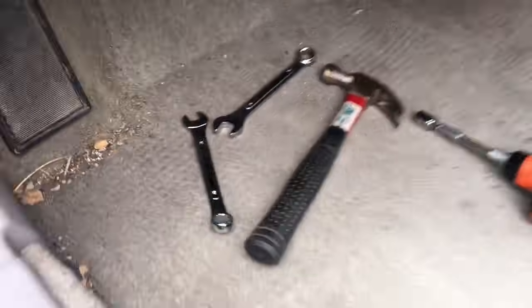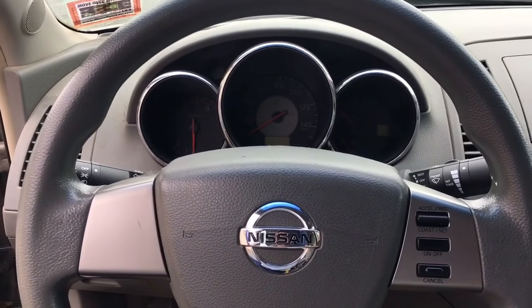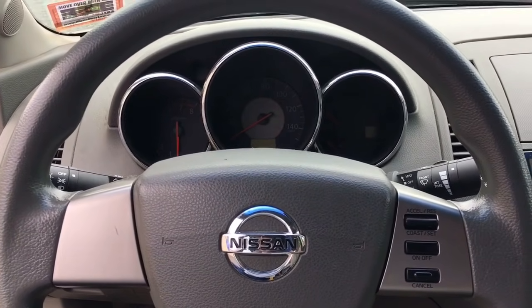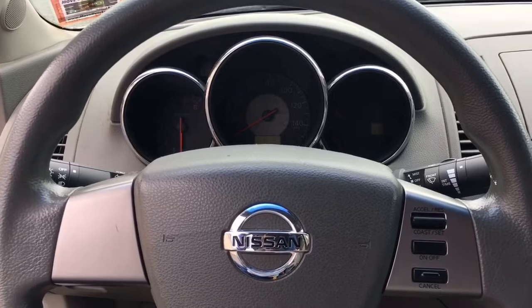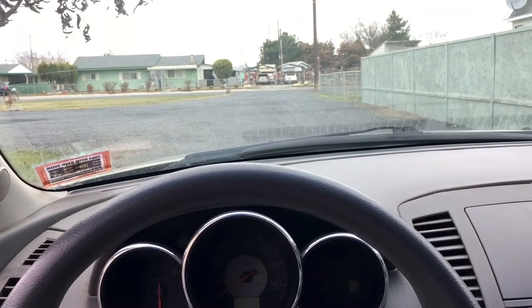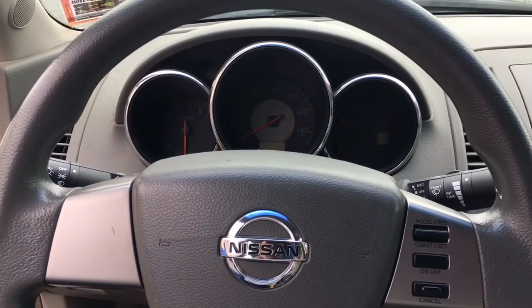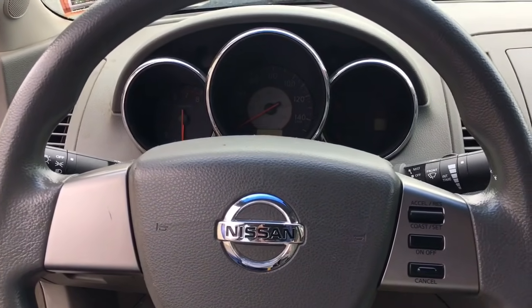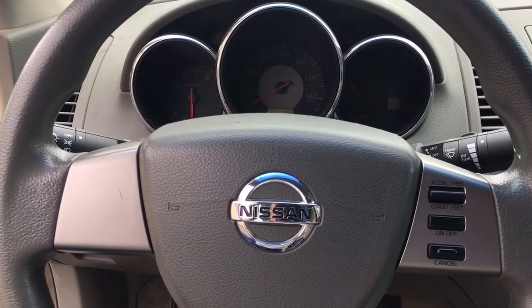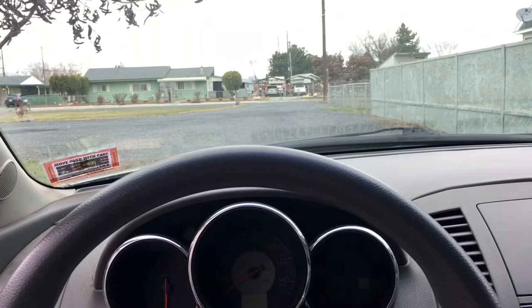So that's how you adjust your steering wheel to make it straight. Look at that — beautiful. I never touched the steering alignment of the car. The only thing I did before starting this job is I moved the car back and forth like 30 feet — throw it in drive, go forward 30 feet in your driveway, then back up to make sure your wheels are straight. Then you can start doing the CV assembly adjustment. Hopefully this helps and until next time, stay frosty.